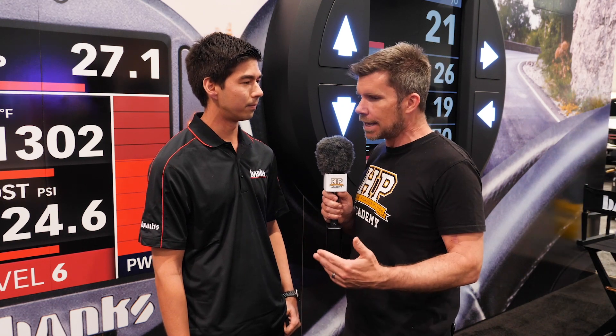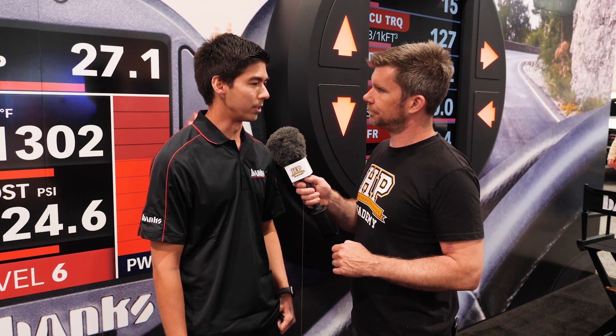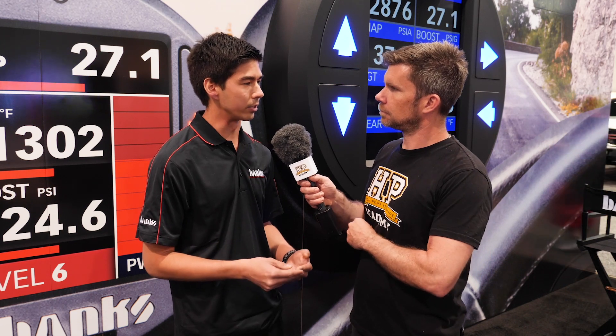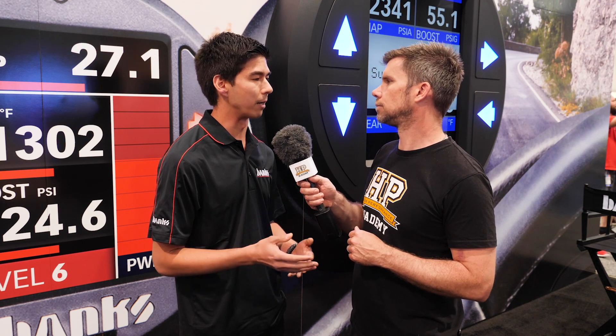As ECUs become more sophisticated, you can't go crazy with fuel pressure or manifold pressure because the ECU will detect something's not right. So what development do you do to figure out how far you can push these things? We do a very thorough calibration — we slowly creep up, adding more and more fuel and air to find the optimal level. If we run into limitations like a check engine light due to the fuel rail pressure signal, we look at exactly where that occurred using freeze-frame data or the data log, then figure out what to do — changing the calibration at one spot, ramping in, or changing the rate at which we're amending the signals.